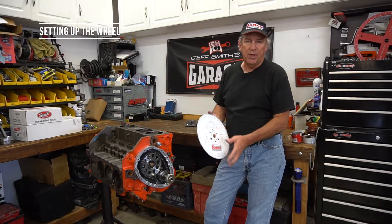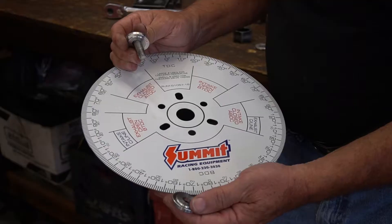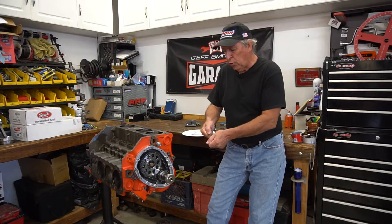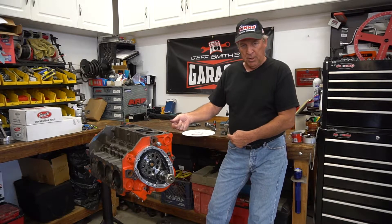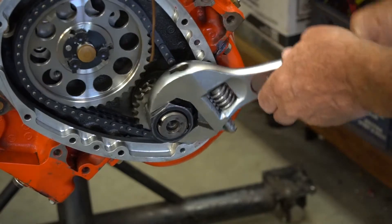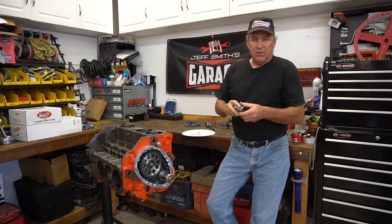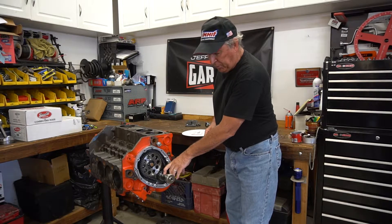Before we get into the actual installation of the degree wheel, there are some tools you need. They send you a series of little flanges to hold it in place where you can just put the bolt on. The problem I've found with that is that in order to degree the cam you have to turn the engine backwards at some point. When you do that the bolt loosens up and you've lost your position — you have to start over, which is very frustrating. So an inexpensive solution is this crank nut, but then you need a giant crescent wrench. By the time you've invested in that, you could have spent the same money on a crank socket — what's on the front of the engine right now. These are from Comp Cams: this is the big block version and this is the small block version, held in place with a little set screw right here.